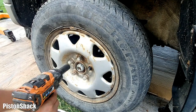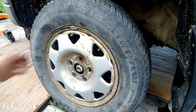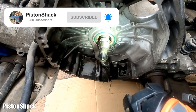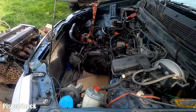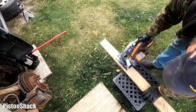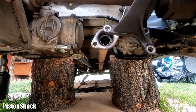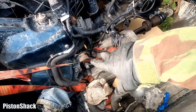Let's take the driver's side wheel off — we need to get access to that part of the engine bay from the side and underneath. As you can see, we don't have the engine; it's pretty empty. We have a transaxle, an automatic transmission, and no engine. We're going to put our vehicle on blocks — cut a two by four, make shims, make sure it sits steady. Look at that — two big blocks, all rigid and solid, and we're safe to work underneath.